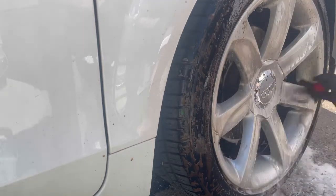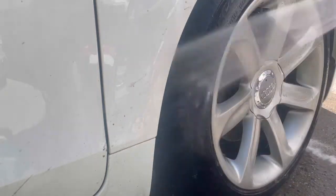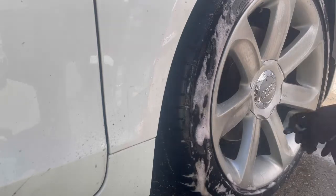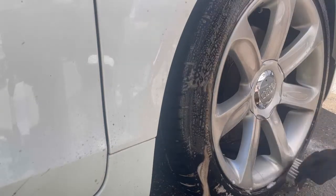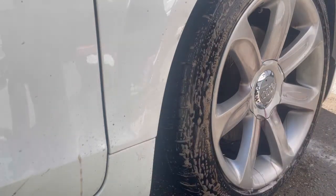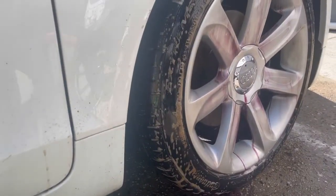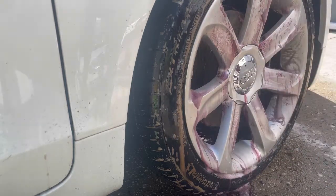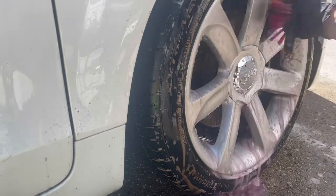To summarize the pros: interior and exterior use, direct sunlight capable, multiple uses based on dilution ratios, and water-softening properties. What are the cons? You just don't get any suds. And one more serious con: if it's a heavy-duty, super-dirty job — like traffic film built up over two months — the rinseless wash can handle it, but you'd need to supercharge it with a degreaser. In that case, I'd just rather use a soap.